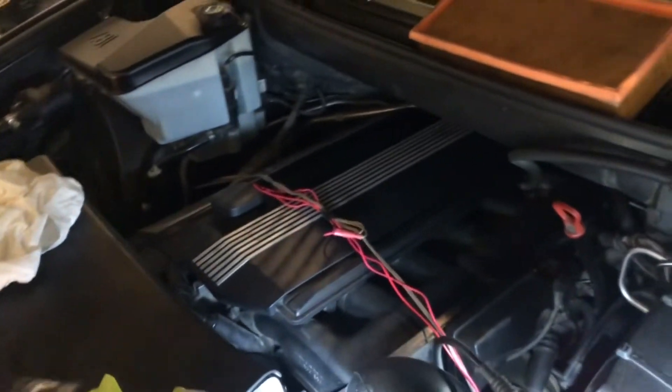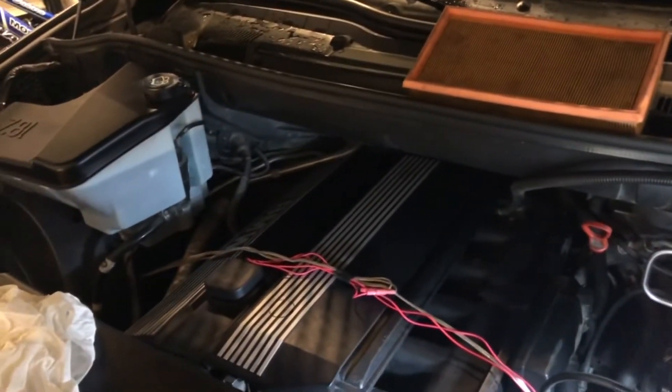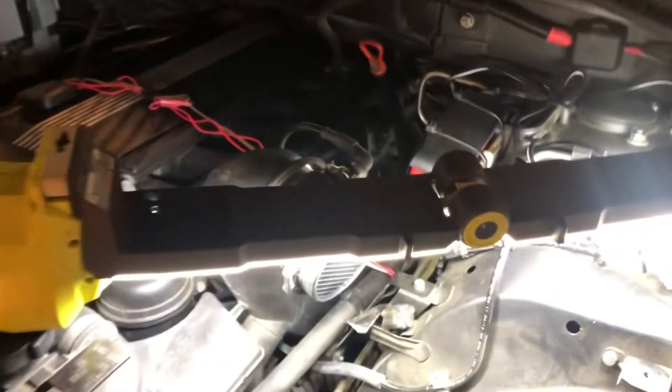I went as far as rewiring the right speed sensor to the left wheel — that's why you can see those wires going across the engine bay. Even with the right sensor rewired and plugged in under the left wheel well, it still said the problem was in the left wheel.